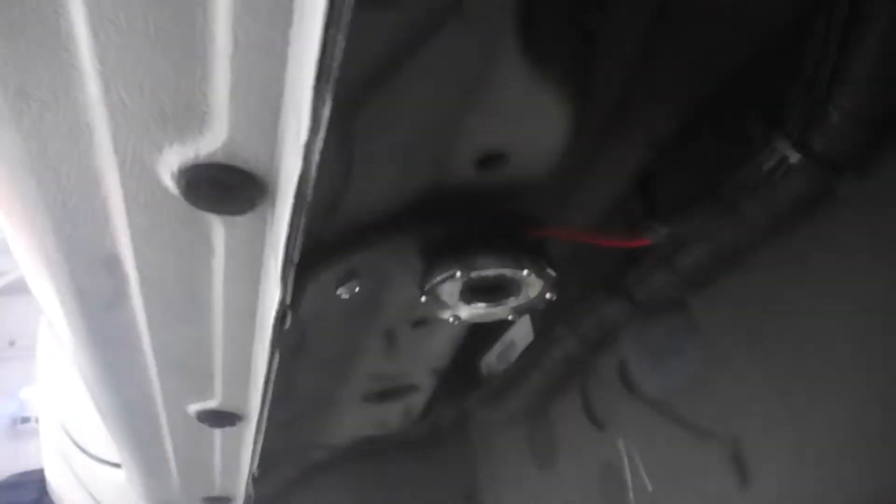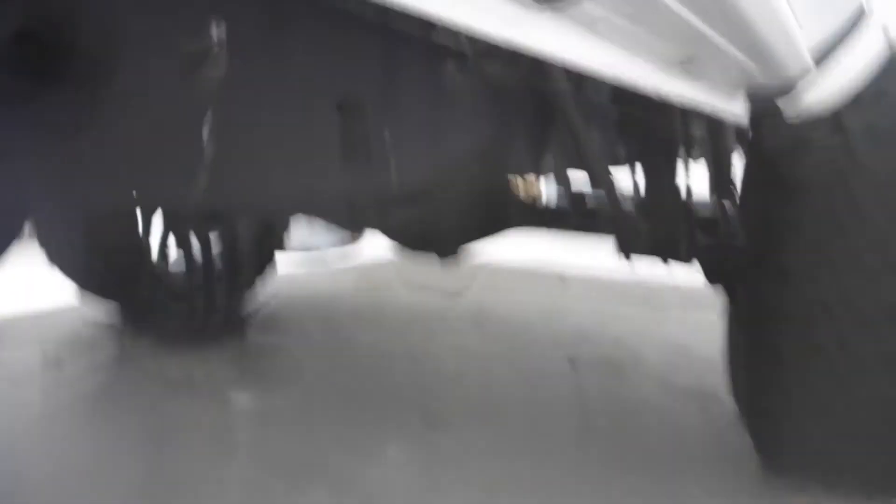We have two in each wheel well and also two along the frame — that one's tucked up underneath there. I like to do these frame rail lighting setups because I get to make these little brackets. Those are made out of quarter-inch ABS plastic, bent so the lighting fires straight down, giving a much more even display on the ground. For the rear, it's the same install I did on the other Tacoma using steel brackets — they go underneath a factory bolt and hang right out in the open, giving a nice even glow onto the ground.